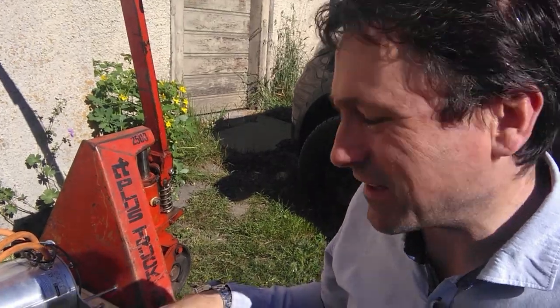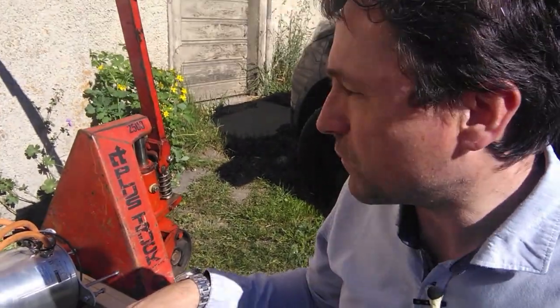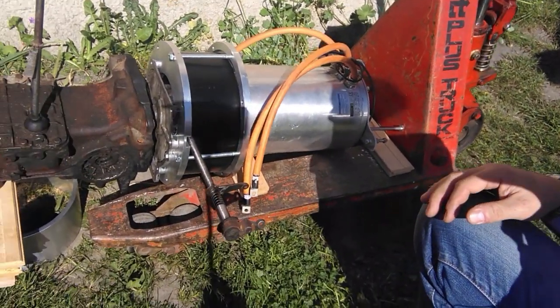So what happened — I think one of the last times we saw each other was when I explained that we have a bit of a problem with the connection between the gearbox and the motor on the Renault 4CV. In the meantime I've been very busy constructing and engineering a solution for that problem, and the whole drivetrain is ready now for install. I have it here outside. The next video will be about the actual install in the car, but this is the first fit to see if everything works as expected, and I wanted to walk you through the different components of my solution.